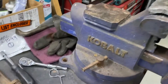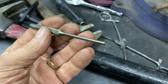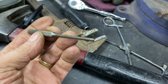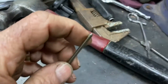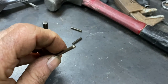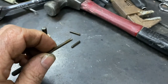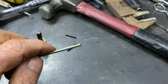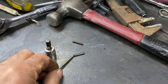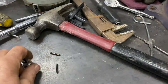By the way, you typically don't see these in the cheaper brands like Craftsman, but these are actual roll pin punches. You see the tip on it — it's not just a regular punch. That little tip really helps keep it centered. I got a whole set of these, Matco or something. For those of you who struggle with your punches slipping off the end, they won't slip on these ones.